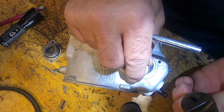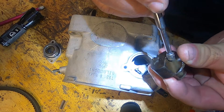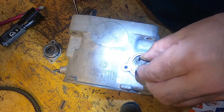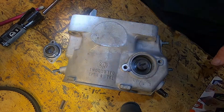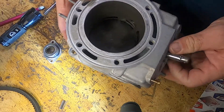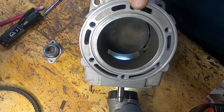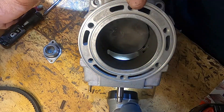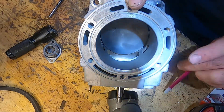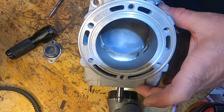That's why it's important to get that pin back into that slot. If we line up our two marks - the arrow pointing that way against that - we're going to put it back together correctly and everything's going to work fine. If we turn our cylinder up like this with a piston in here and shine a light in the exhaust port, we can see our exhaust valve is down in the closed position. That's where we're going to be at low RPM, probably below about 6,500 RPM.